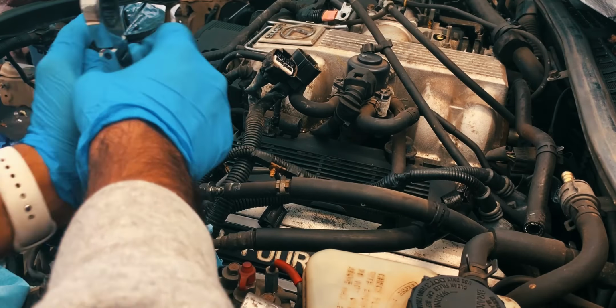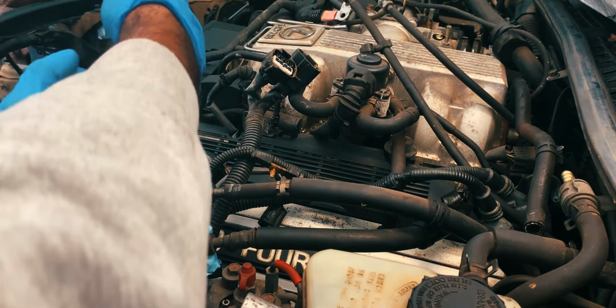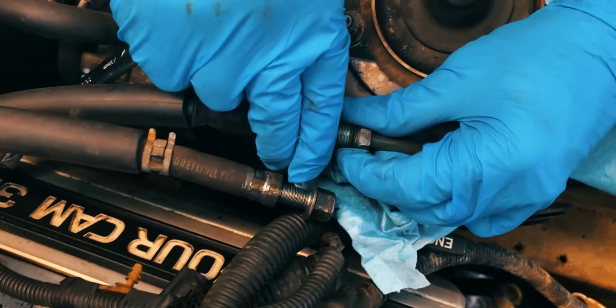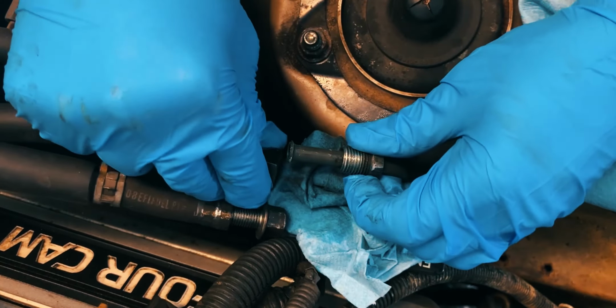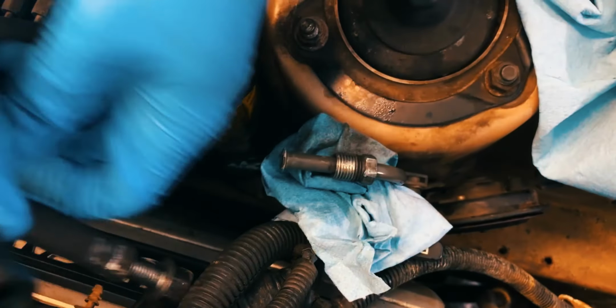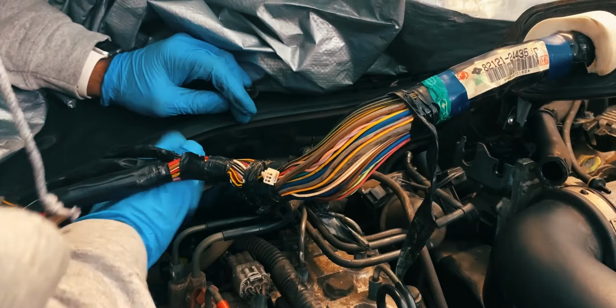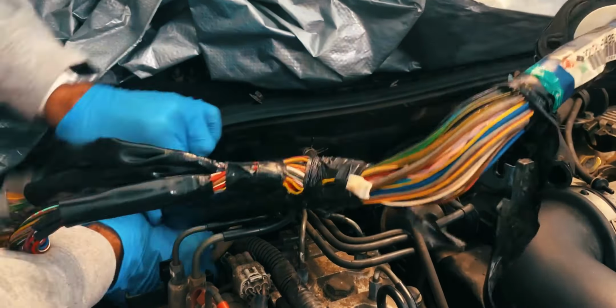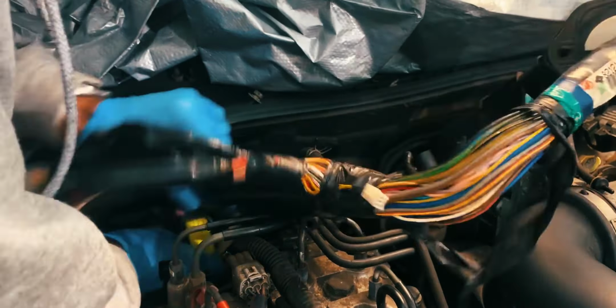The next day, the motor needed to be prepped for removal. I disconnected the fuel lines leading to and from the engine, and Steven disconnected the radiator, the vacuum hoses, the power steering hoses, and anything else that would prevent the engine from coming out. The ECU harness was also unplugged from the ECU and removed through the firewall.